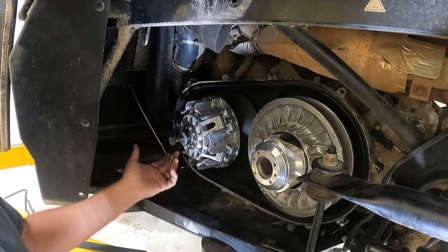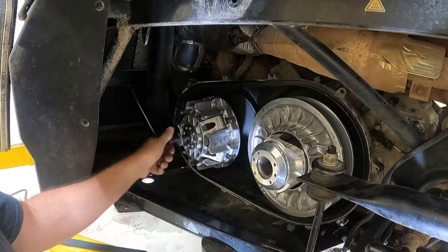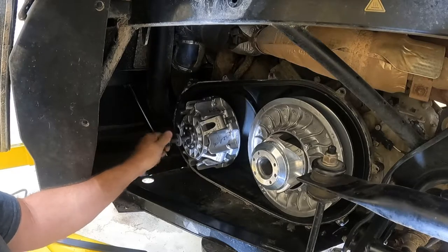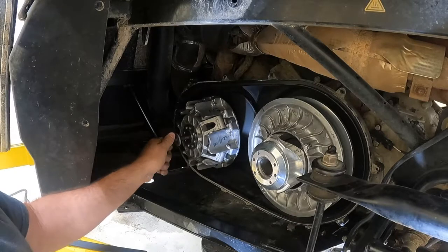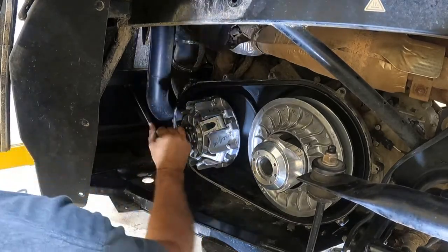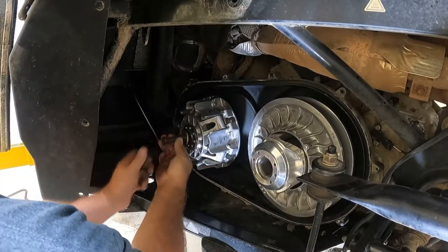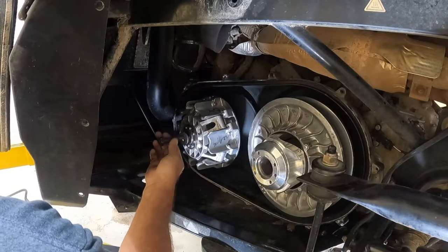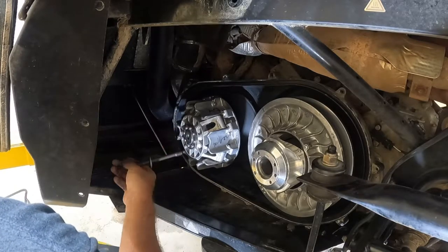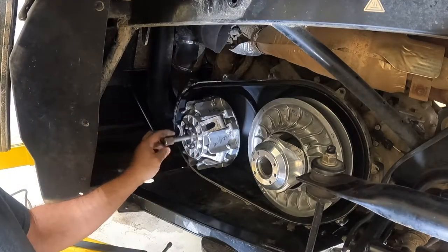Once you get the bolt out of the crankshaft, you're going to see that it won't come out — there's another set of threads in the primary clutch, and the primary bolt must be screwed through the clutch. I'm not a fan of this design at all; I think Polaris has it beat in this area. Just continue through the threads until the bolt is completely out. Then take your puller and screw it in — we offer these pullers on our website on the Can-Am Defender page.